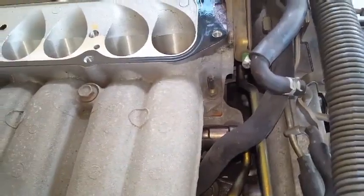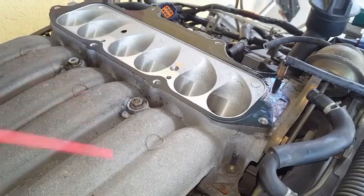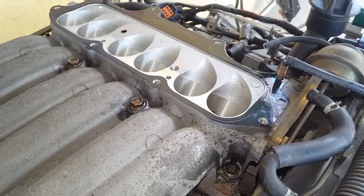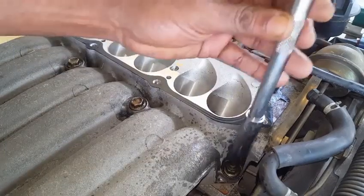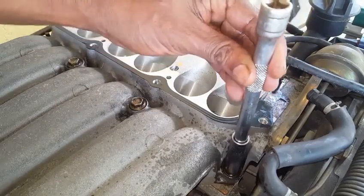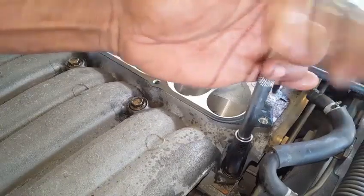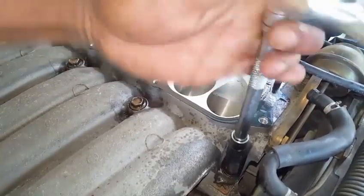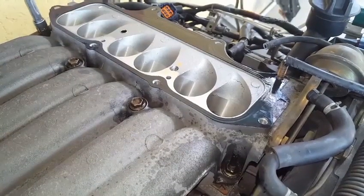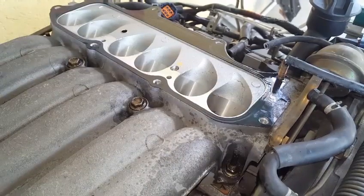First thing first is to always apply the penetrating lube oil. Then we will use our 12mm 6-point deep socket with an extension to get down on that front bolt for releasing. Same thing for the rear. Actually, it's a nut and not a bolt. The bolts are in the center.